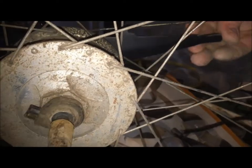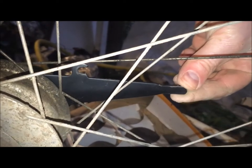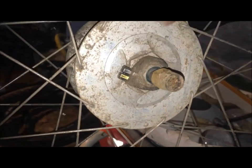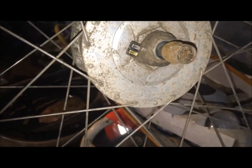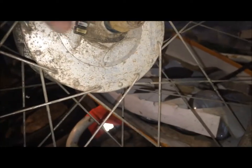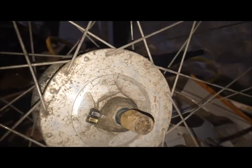One last tip I forgot about: make sure that when you put the assembly back in, you can see the arm on the other side for the brake sticking up, and the dynamo contact connector here — it needs to be pointing in roughly the same direction. That way the connector will be tucked in behind your fork stanchion rather than sticking out the bottom where it can get hit by things.